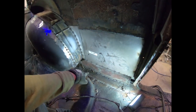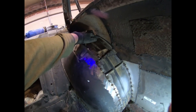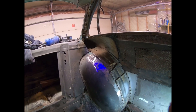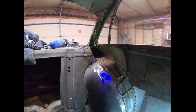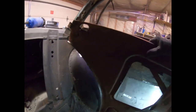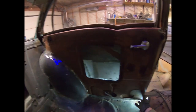I got this piece in, attached a little piece of the floor there. I didn't go too crazy — just put a few welds in. On these old ones you can actually see this corner is just a piece of rubber, so the inner wheel wells aren't even attached to the actual fender, which is kind of crazy. I ground down the leading edge and around there we're gonna weld it. Across the bottom I've probably got to make a piece yet because there's a bunch of rust chopped out in the corner — I chopped a bunch out but kept a little piece so I can put it back in. This section has to actually tuck in the back there so you end up cutting out a little more metal than you want.